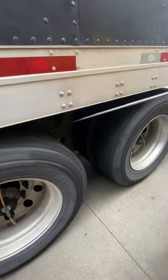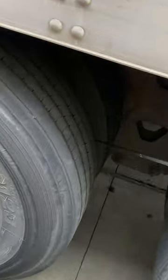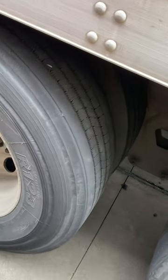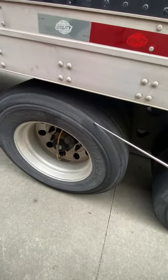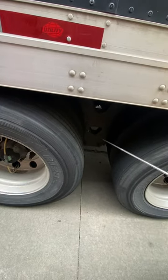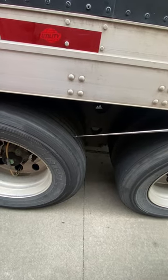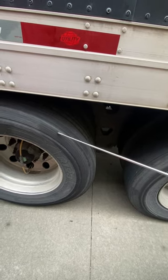Coming back out to the tires, we need to check the butt space — the gap between dual tires — to make sure it's free from debris and even all the way around. Tires are properly mounted and secured, no abrasions, bulges, or cuts, and no leaks. The tread face is evenly worn. Tread depth must be at least 2/32 of an inch on the rear tires. Check it with a feeler gauge or tread depth gauge. This tire can be a recap.